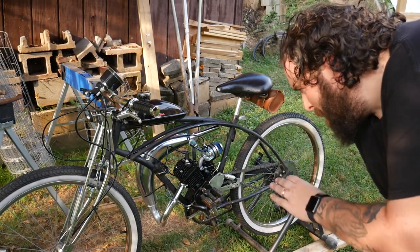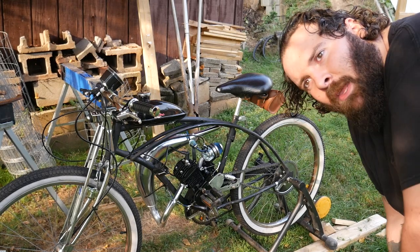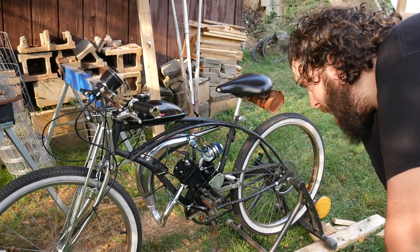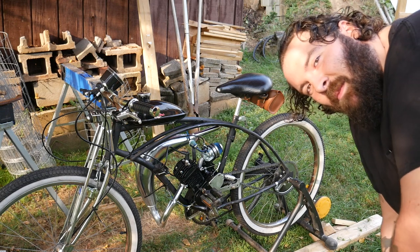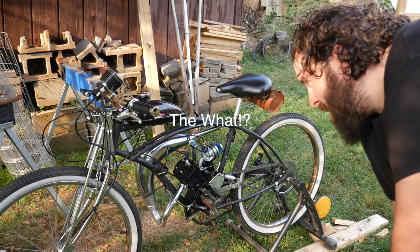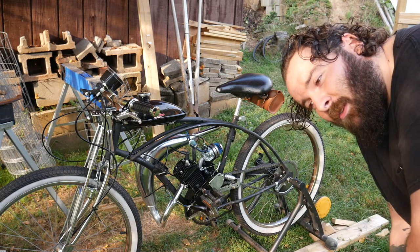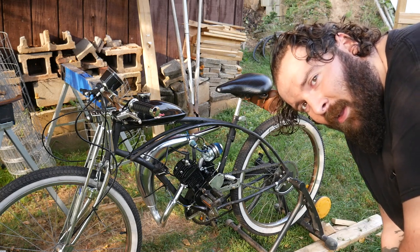Okay, here we go. So, new carburetor is on. Exhaust is 90% installed. I fired it up already. It's pretty good. I'm surprised. I did have to work a tiny bit with the throttle cable. Had to shorten the housing to make it work for this, but this thing idles amazing. Here we go. Fire it up for you.